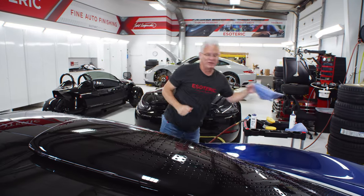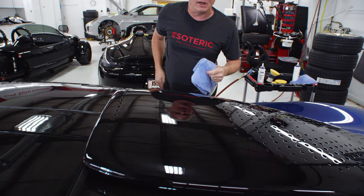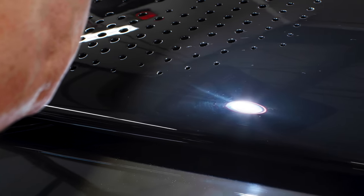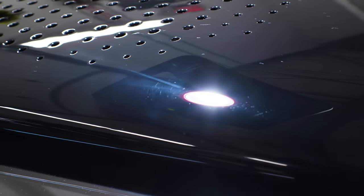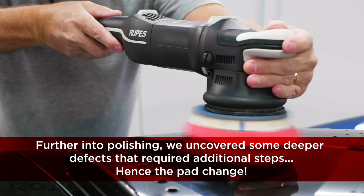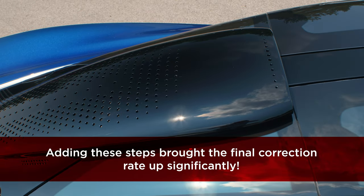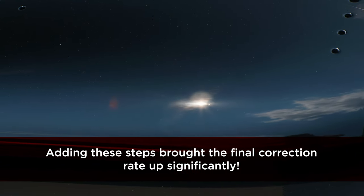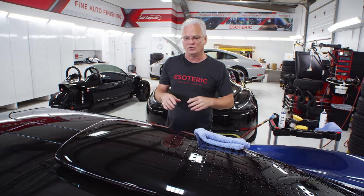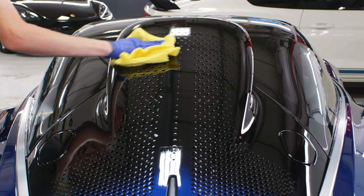Now I've got to battle the sound of the air compressor in the background, so excuse us for that. Now we'll wipe things off and take a look at what kind of correction we got. This did a really good job. I've got a couple things left over right on the curvature, which I think I can take care of with the yellow pad and Perfect Finish. The haziness is gone. The clarity is good. It comes back ultimately to what the expectations are with the customer. In this case, I know they want this thing to look as good as possible. I'll continue on, do all the rest of the polishing on this piece, work around the holes, then clean everything up. I'll have the rest of the team come in a bit later to do all the coating on top of the surfaces.